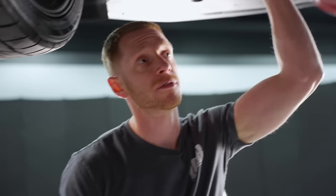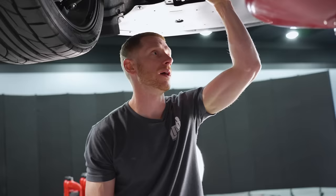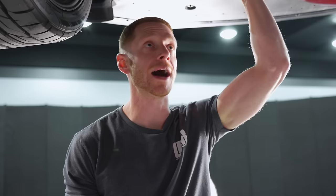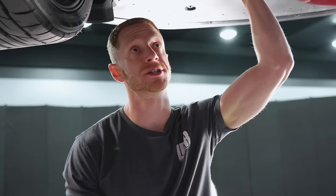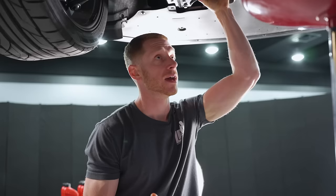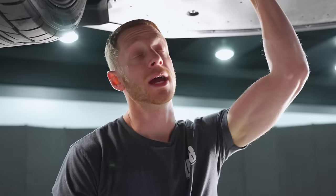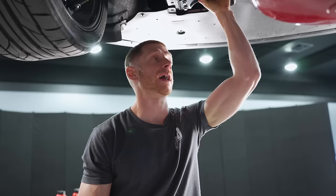While we let the oil drain, here's a talking point on the infamous typewriter tick, or barbecue igniter tick. It can happen at any point in the car's life — they haven't really pinpointed it to mileage. A lot of people report the noise happens after the first oil change. According to the document Ford put out on this noise, it's not detrimental to the engine — it's a normal operating characteristic of the 5-liter Coyote in the Mustang and F-150.